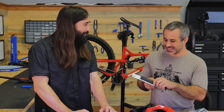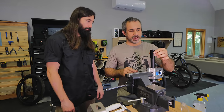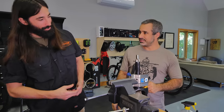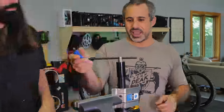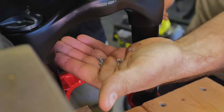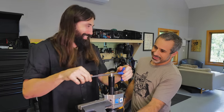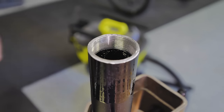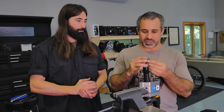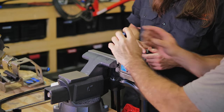Part of this bike upgrade is getting an integrated multi-tool into your steer tube. I use the 1UP EDC — you guys have seen it a million times, you probably think I'm sponsored by 1UP by now. I'm not, I just love this thing. We're gonna put this in the vise and I'll show you the threading kit. You put this on, put this over it so it's in there straight, put a little bit of oil on it, and you start tapping — full turn forward, then back a quarter turn, so it's clearing the chips out of those threads. You should have beautiful threads when you take it back out. So the cap goes down into your fork to tighten it, and your tool fits right inside and presses right in.